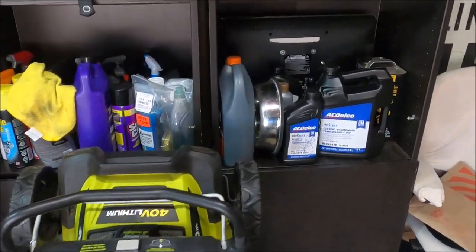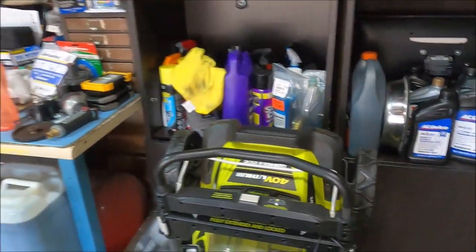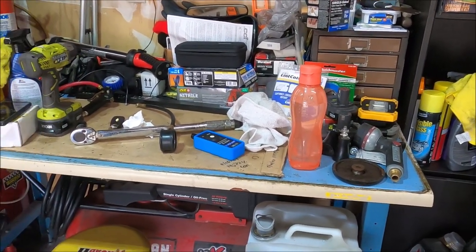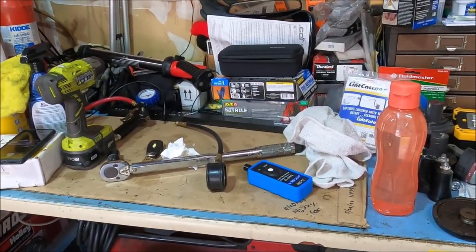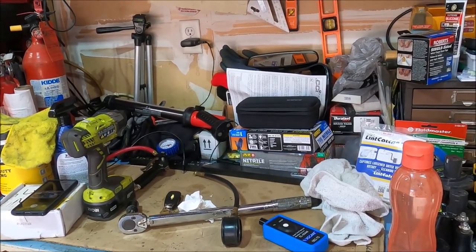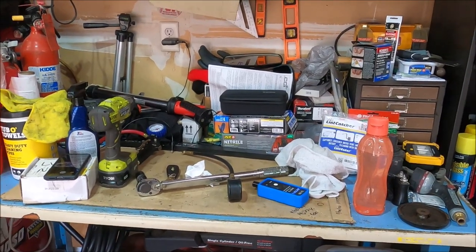Changed the oil with the maximum, what is this? Oh, Valvoline extended protection. Looked pretty normal after I did that flush last July. I've got to say that maximum protection, I think it consumed less oil than the Valvoline Modern Engine that I've been advocating for 4 years. There really wasn't a lot in the catch can. Usually I'd be about a quarter quart down on the stick and it didn't even register. It didn't look like I was hardly anything off the needle.